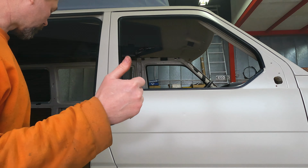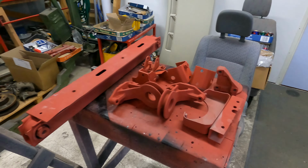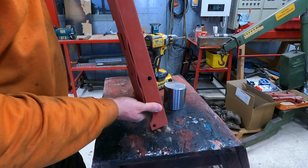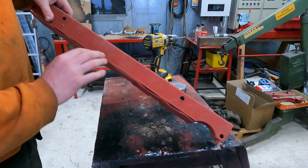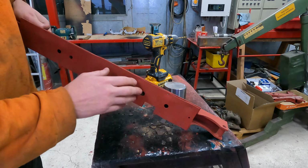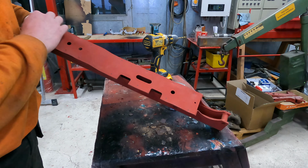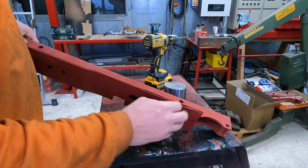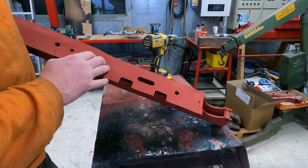I have lots of parts which I still need to paint, same as my differential carrier for the rear axle, which needs paint, and this one is very rotten. You see how much rust there is inside here. We sandblasted this last summer, no, one year ago in spring, but I'm going to drill out those spots and check what this one is like. I know some company sells new fresh-cut steel pieces here, but I think it's not so rusty, so I'm just going to drill out and bang out those rust places and make some extra-strength welds here. I think it's going to be just fine.